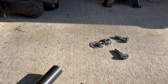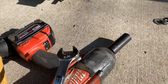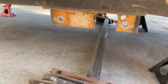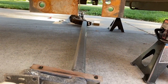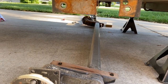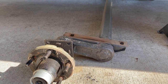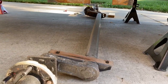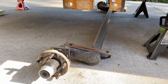They're three-quarter inch bolts and they were on there firm — I needed a heavy impact wrench to get them off. They were also friction-stuck, so a couple of wraps with a rubber mallet helped. I supported the other end on a jack temporarily, loosened that end with a single bolt through holding it up, then a couple of wraps on the hub and she dropped down real nicely. Now we'll get out the lift kit and put it on.